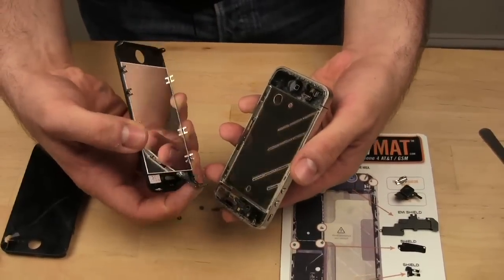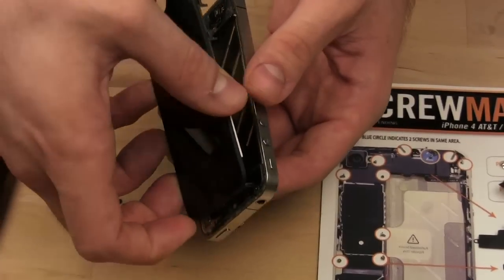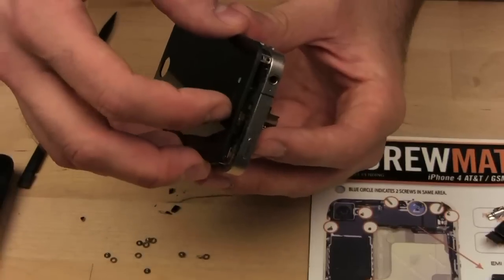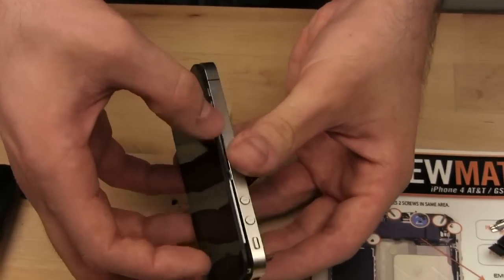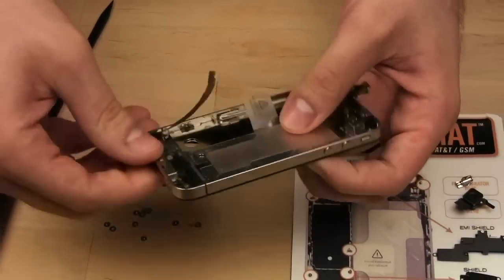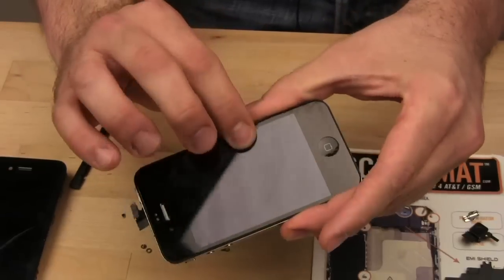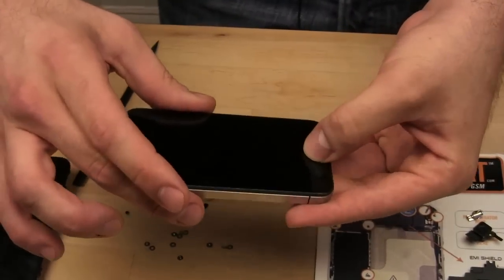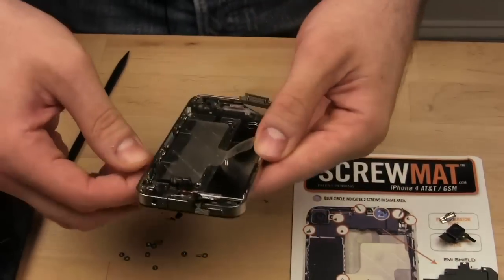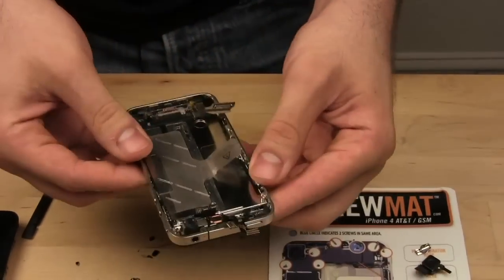Put these two connectors, slide them in through the opening on the iPhone shell here. I don't know if you can see that. Once they're through, line up the tabs and push together. And there you have it. Now, as I push it, I get fingerprints all over it, but you get the idea. All right, so you could always clean that off with Windex afterwards. So just make sure everything is nice and firm, that it feels right before we start putting it back together.